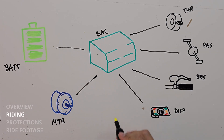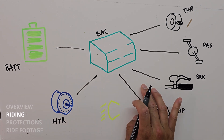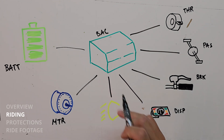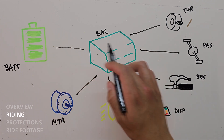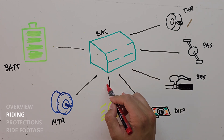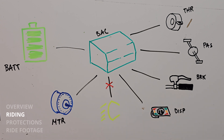One last note on riding features: we do not support lights yet, and here's why. In some manufacturers' bikes, the communication between the controller and your lights is sometimes proprietary. Because all of these components in a stock bike are communicating on a proprietary interface that we're replacing, we can't just piggyback into the lights — that's why this controller does not support lights. We can't get into the proprietary system without getting in trouble.